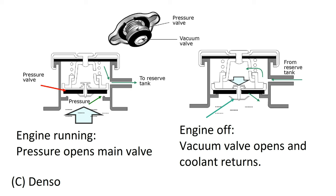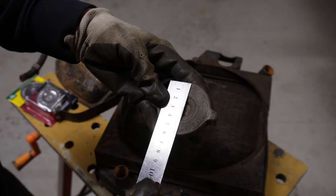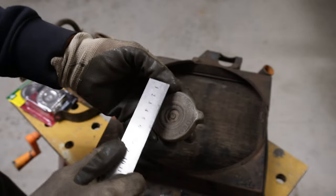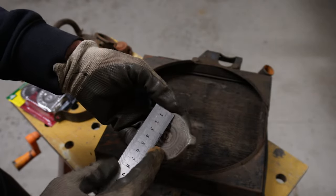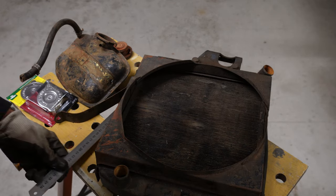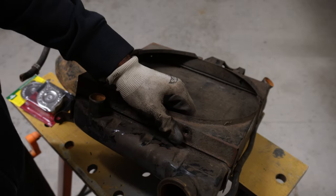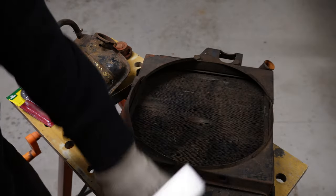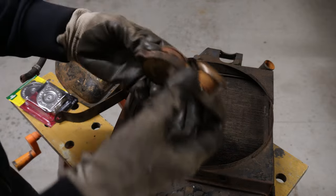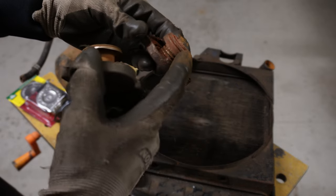There are a few different types of caps. These ones are about 59 millimeters — on my classic Mini it has a smaller cap which is about 44–45 millimeters, so this is the larger size. The other difference is the neck height: some have a longer neck than others. This neck is three centimeters, so you can see this one is a lot taller — that's a long-neck radiator cap, and this shorter one is for a short-neck radiator.